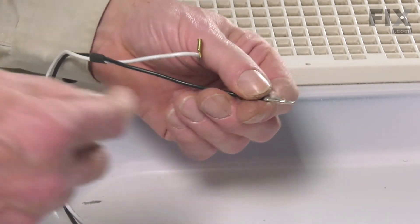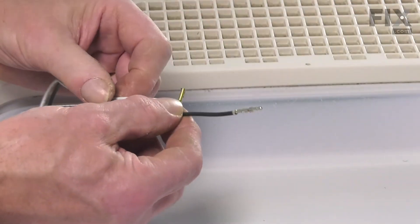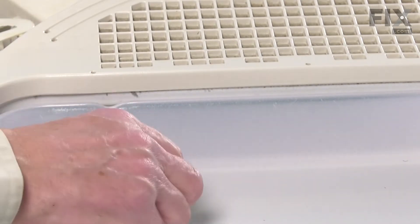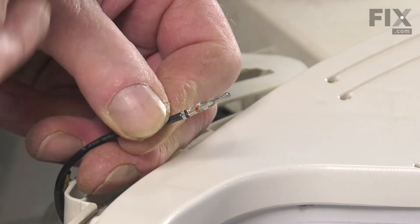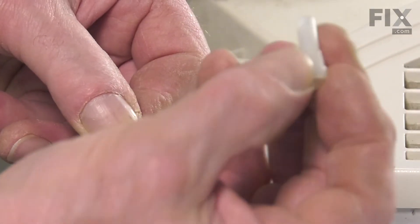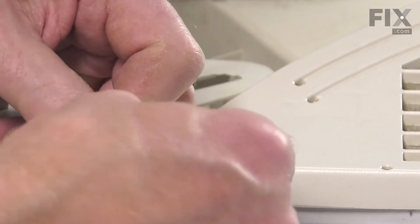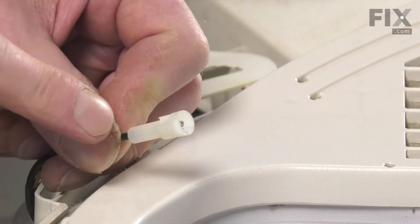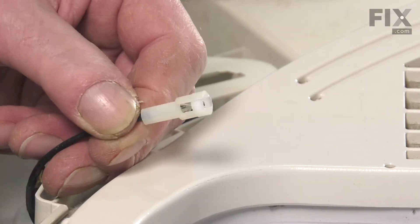You can accomplish the same thing with a tiny jeweler's screwdriver — just bend those tabs in and out of the way, and that will allow us to slide that plastic piece off. Once we've done that, we can discard that old socket. Before we install it on the new wire, inspect those two little metal tabs and make sure they're flared out. When installing that plastic housing, put the narrow end on first, press it firmly down onto that wire end, and then give it a little tug to make sure it's locked in place. You can look through the opening on the side and see that those little arrowhead tabs have caught onto the shoulder of that housing.